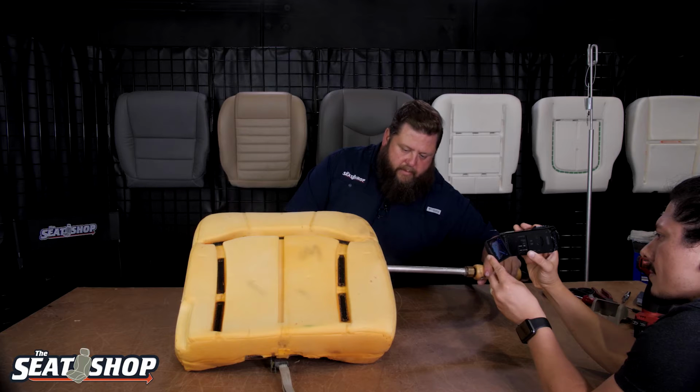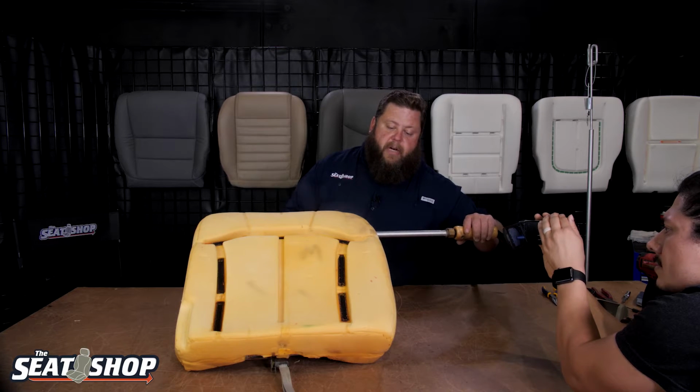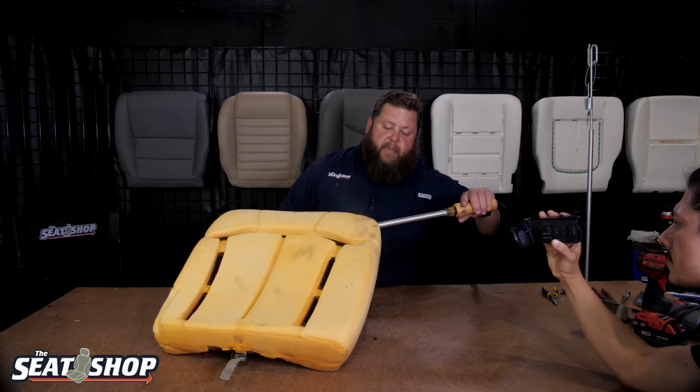You see, some of this we're getting 1/8 or 1/4 inch rise out of it. You think how much surface area that is. If you got that much rise out of the whole entire cushion, when you put the new cover on, that can make a real big difference on if it's going to look loose and baggy like some kind of crap Walmart cover you just bought, versus something that fits on there correctly and nice and tight and smooth. So steaming it out makes a big difference.